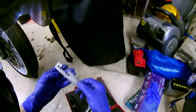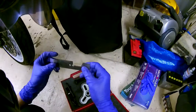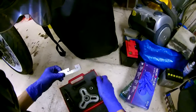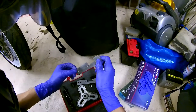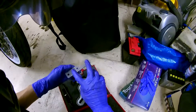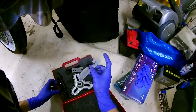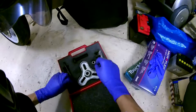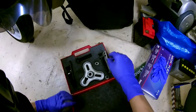It may be worth making up a bracket that looks a little bit like this. This is just a piece of 5mm thick aluminium — I've got two here. Basically what this allows you to do is bolt it to the flywheel and lock it in place to stop it rotating while you try and undo the nut, because that will be a problem.